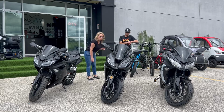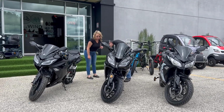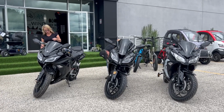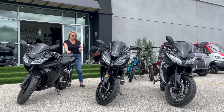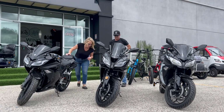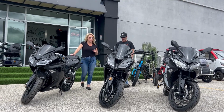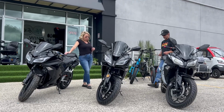Suspensions. Would you adjust the suspension on there? I don't know. I'm not sure. Darren doesn't like to really screw with the suspension. You can adjust the damper on that, but you can't really adjust the height. It's just a different damper, shock, not the height. You can change your shock out a little easier if you want. It's not adjustable for height. Okay, well, change it to a shorter shock if you want to bring that bottom end and that back end down. Okay, that's convenient.